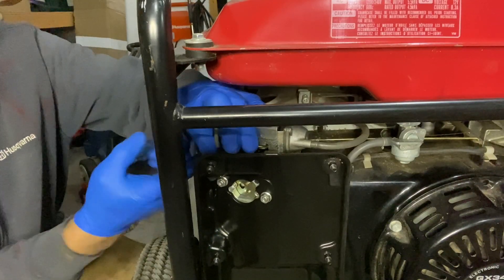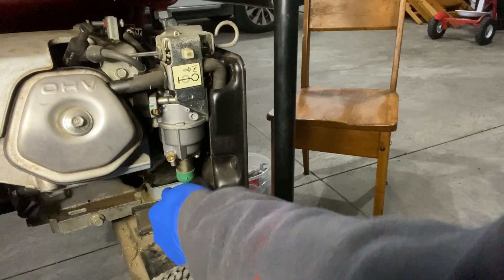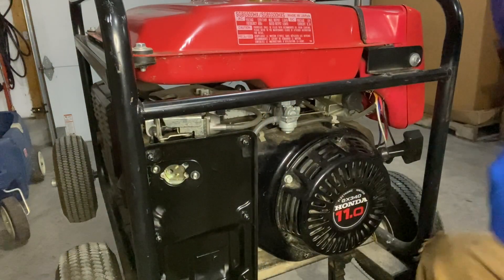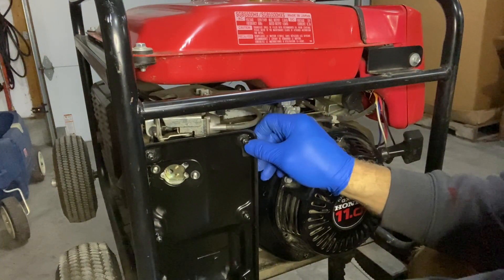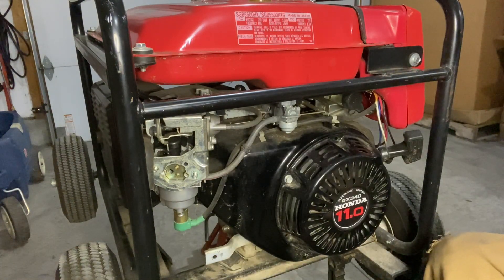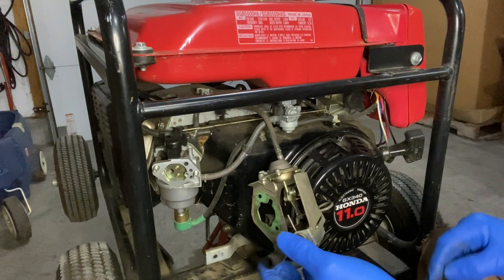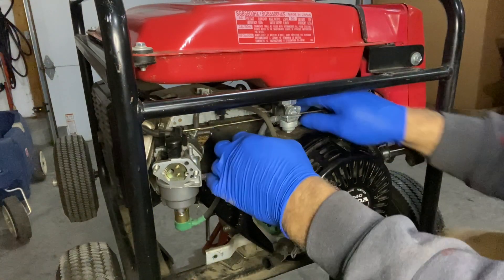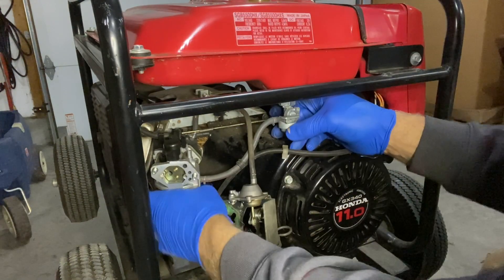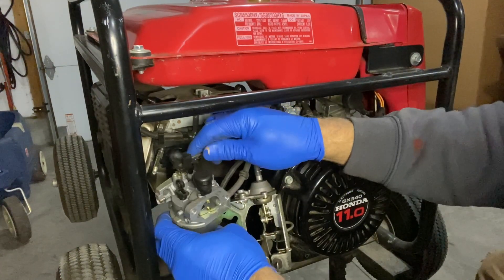There's a little crankcase hose here you just pull out, and there's one more down here from the back side. Most of the screws you need on this whole repair are 8mm and 10mm socket — that's how most of the Japanese put their stuff together, with 8mm and 10mm, which is kind of handy. We're just going to pull this off the studs and let that hang down there for now. This wire here comes off the bottom — that wasn't so bad. Pull the carburetor out off the studs and make sure you don't bend the linkage.